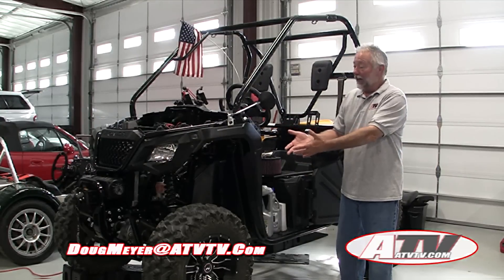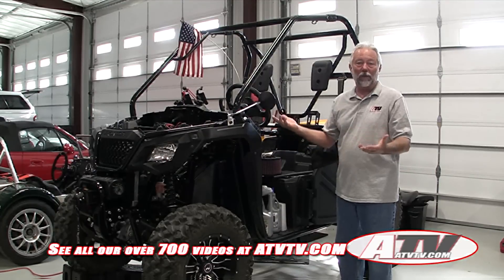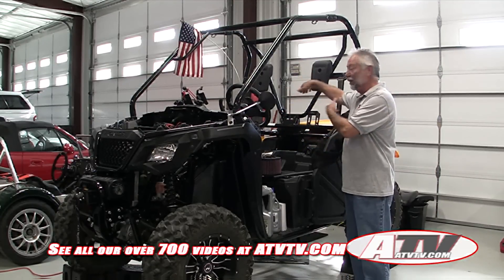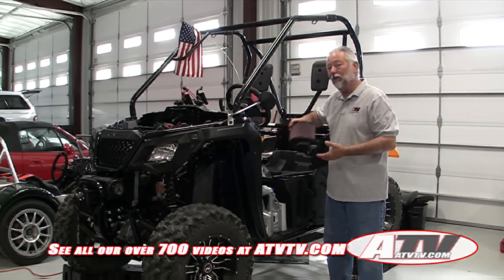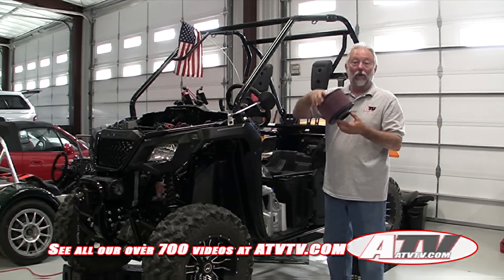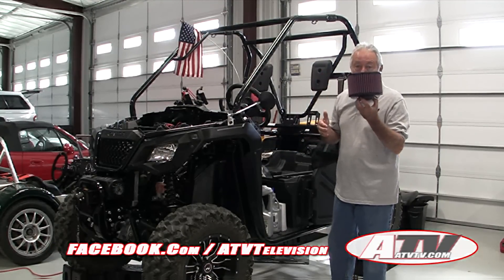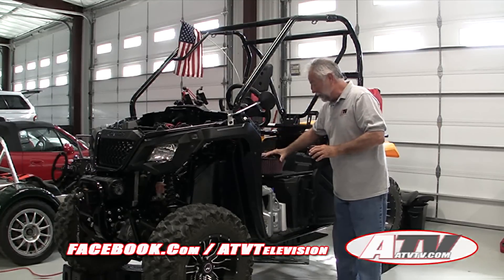You get something like this little Honda Pioneer — we're 475cc's and 1,000 pounds before two people and all our gear get in it — so you can use any help you can get. I really don't want a louder exhaust on this, so the answer for me is to put a freer breathing air cleaner on it.